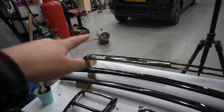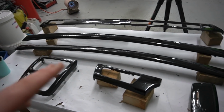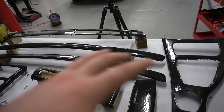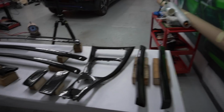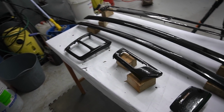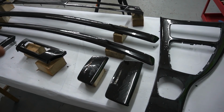I've got the heater on right now because the ideal temperature for this kind of stuff is about 20 degrees, and right now it's about 7, so the heater will basically help the resin. So yeah guys, what I'll do is I'll let that sit for about 2 hours and we'll come back. Guys, so 2 hours have passed and the base coat is nice and tacky. It is ready now for the carbon fiber.